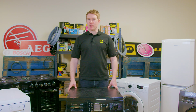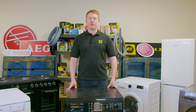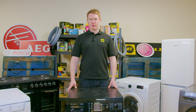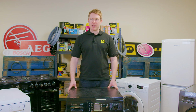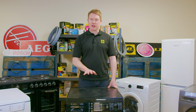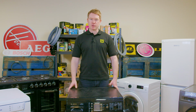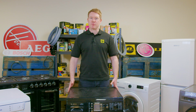In this video I'll be showing you how to fix your Bosch washing machine if it's showing the error code F27. If your washing machine is displaying the error code F27, this indicates that the machine is overfilling with water due to a faulty pressure switch. So to sort the problem, you're going to have to replace the pressure switch.